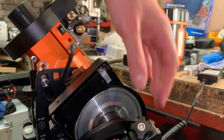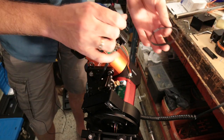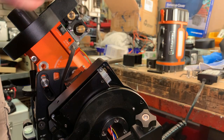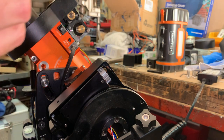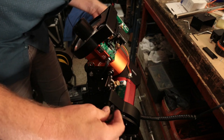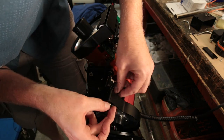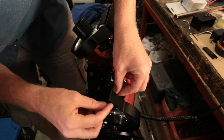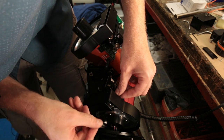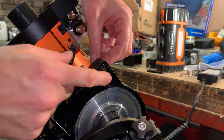There's a hole over here where I can make everything go through. The bad belt is this one. If I press it in here I should be able to grab it from this end, then rotate it — do it like this. So now it is on the small sprocket over here, and now I'm going to try and slide it over this big sprocket at the worm gear. Now it is on — that's nice.